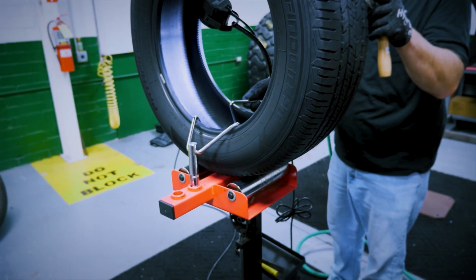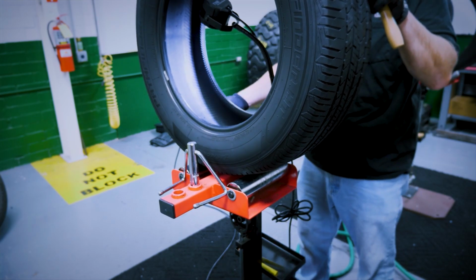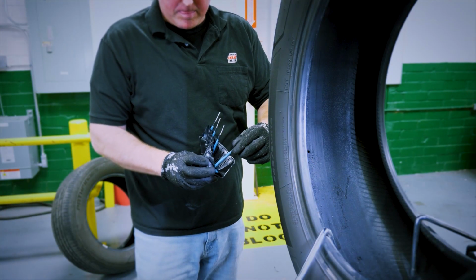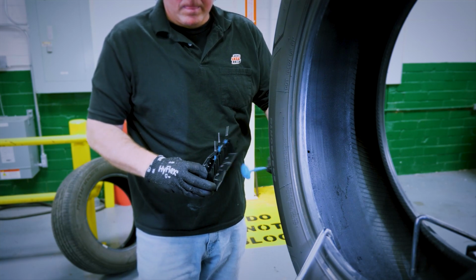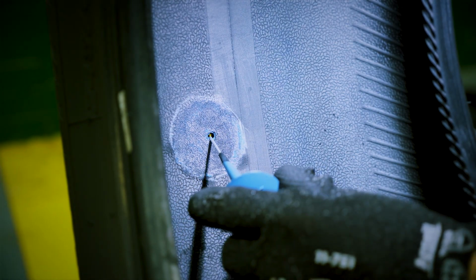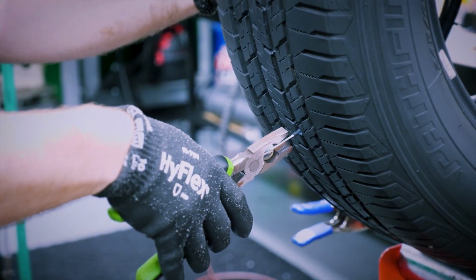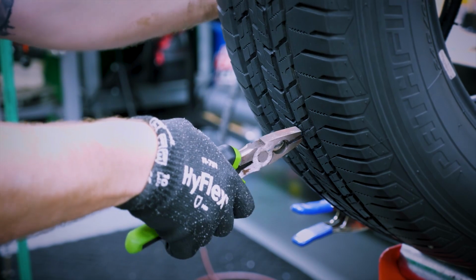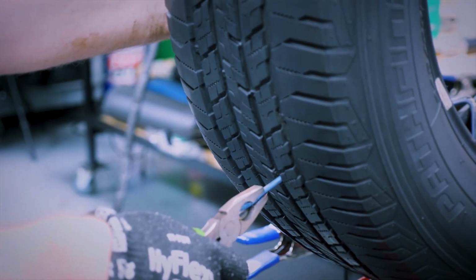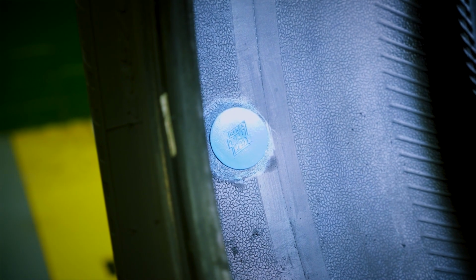Once the cement is dry, relax the beads of the tire from the spreader. Remove the Minicombi carefully from its protective cover and avoid touching the bonding layer of the Minicombi. Insert the guide pin and stem through the cemented injury channel. Pull the guide pin through the injury with pliers. Release the pin and grasp the rubber stem of the Minicombi and continue pulling the stem until the Minicombi base is flush with the tire and slightly dimples against the inner liner of the tire.